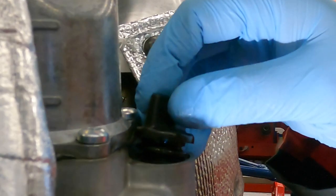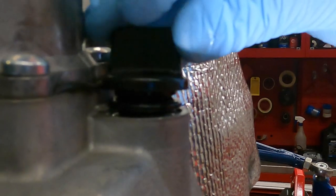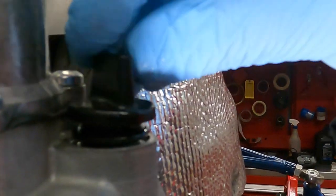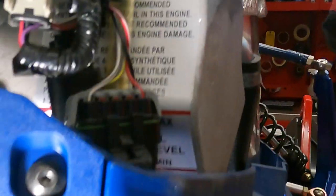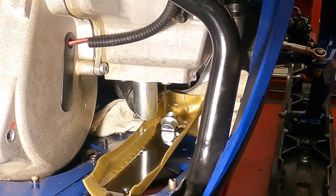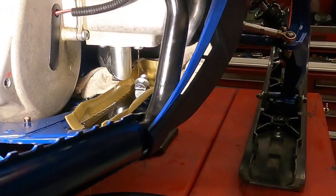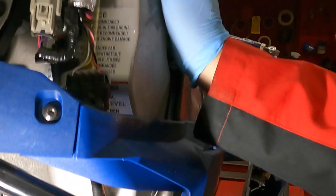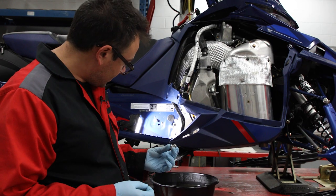So to keep a smooth pour with the drain that we have set up there, I just slowly back off the oil fill cap. So I limit the amount of air going into the oil tank. And by doing that, I can slow down the flow so I don't overwhelm our little trough there. We're almost done now, but it'll keep it from going too fast. So I just slowly start to open the oil fill as I wanna get a little more flow and let the air out. As you can see, our oil looks like it's just about done draining.